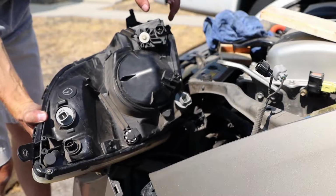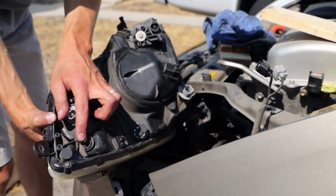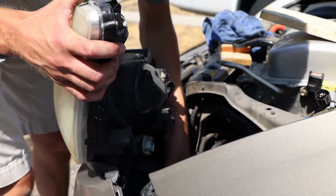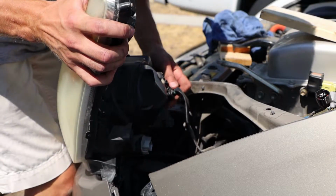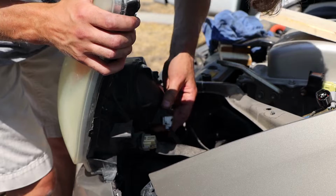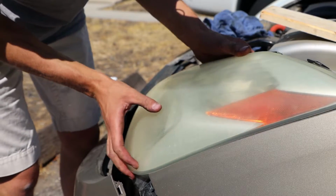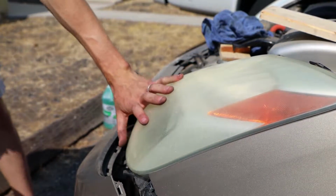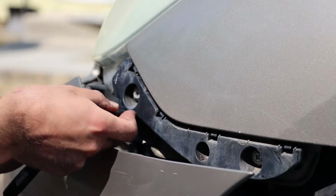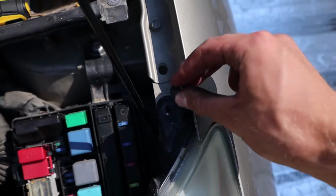Next step, headlight. Remember, you have 5 connectors that you have to pair up with the appropriate plugs, so find those, hook them up, and when that's all said and done, put your headlight back in its place. Now, if you do this correctly, the headlight should sit in there just fine without any play. Tighten down the bolts to the headlight, starting with the one tucked underneath the bumper. That's followed by the other two bolts up top and down low.